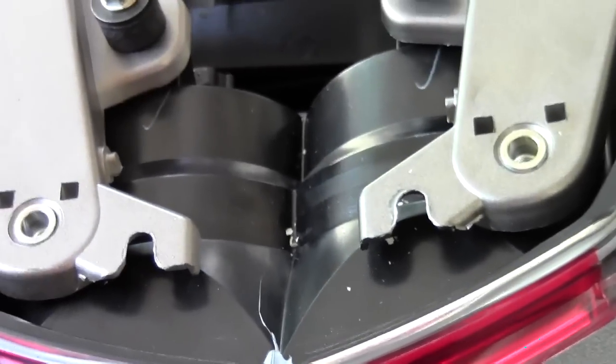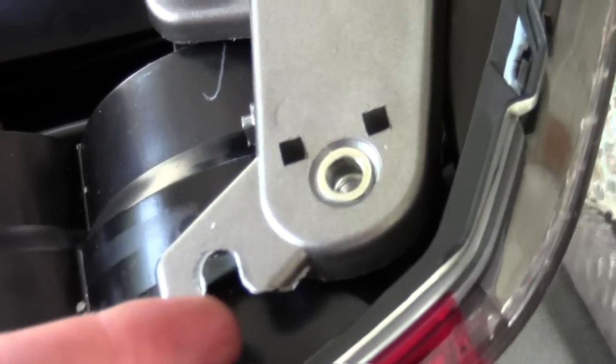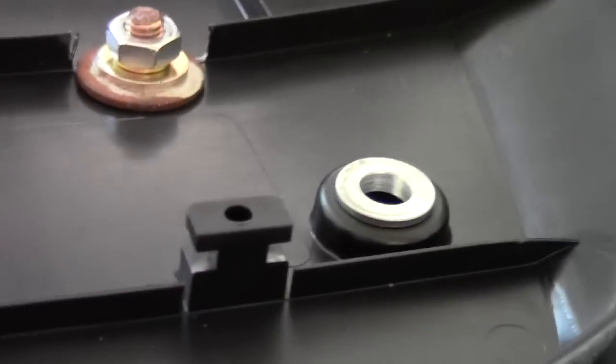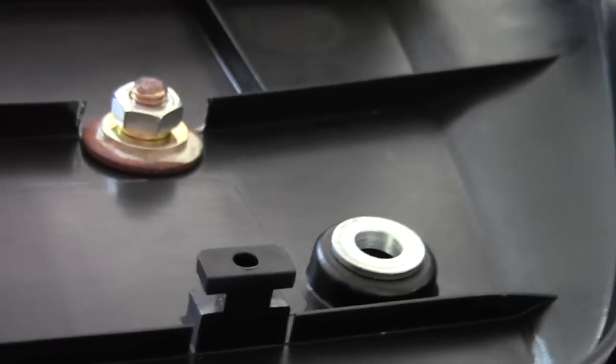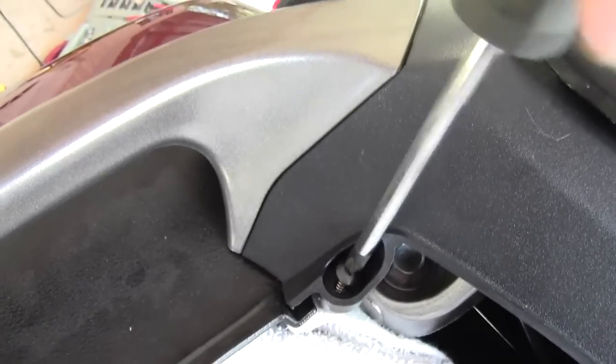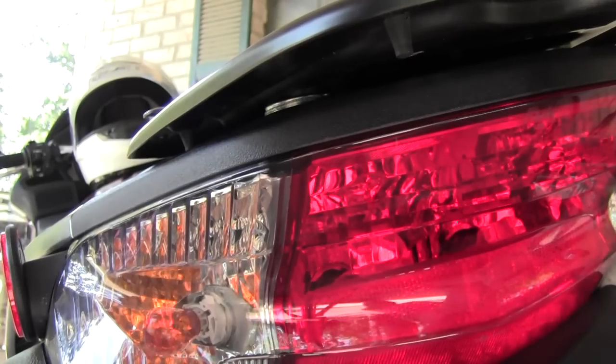When I'm putting this tailpiece back into place you'll notice that there are a couple of little slots right here. And on the tailpiece itself there are a couple of little posts, and each one of those little posts has to slide up under those notches there. There we go. Get that screw back in there and that will hold it on.